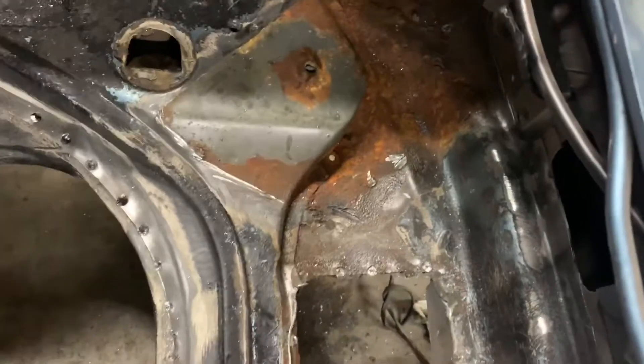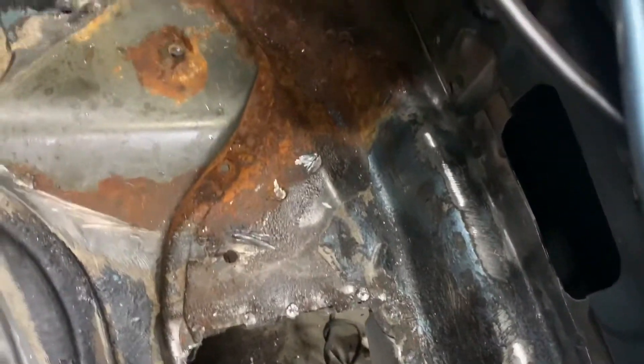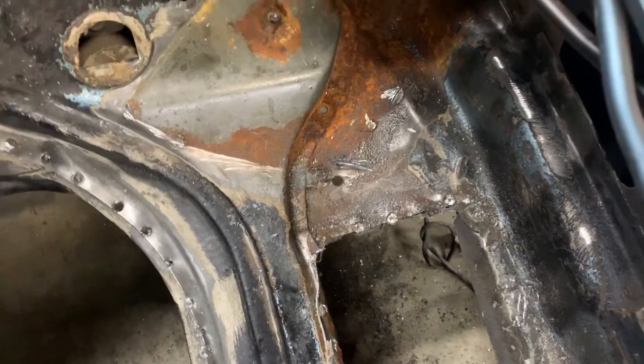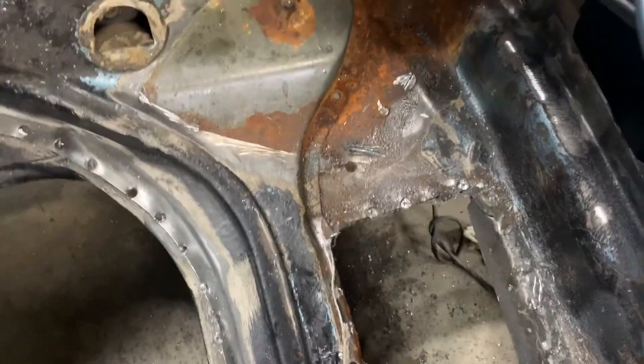Sheet metal coverage is going on slowly but surely. I've drilled out to that corner right there. I need to wire brush it all just to get it exposed — the rust has pretty much taken over all over there — but at least there I need to uncover it so I can get at the spot welds. We're getting really close to being able to take this thing off.